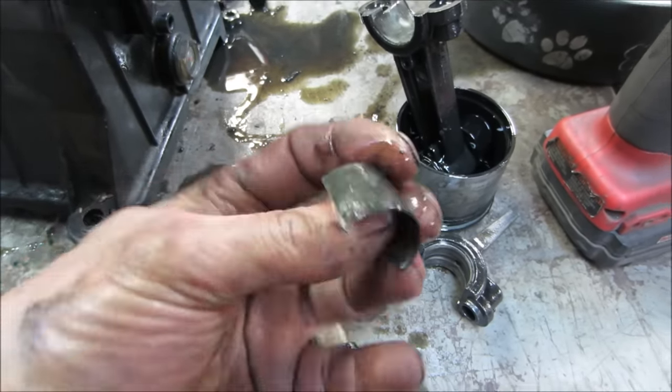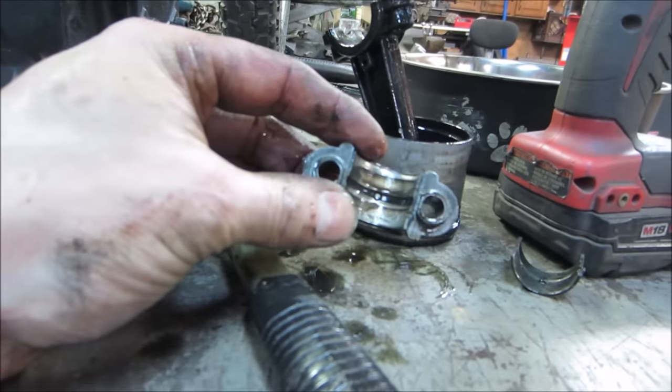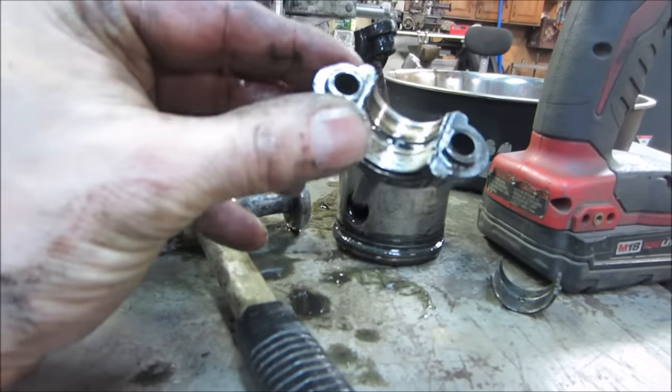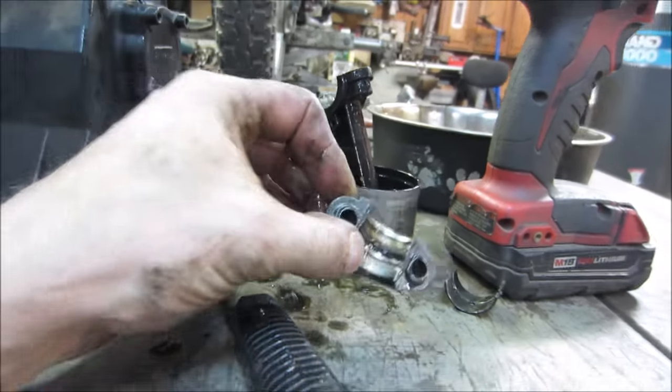It's almost through the bearing altogether. It didn't spin — it's still locked into the tabs. Sometimes it's funny how just the one hammered itself to death. It's flat too — you know, a compressor lays on its side, so you can't say one side took damage because it was higher out of the oil or something like that. I hope you can get that out of there. I would think it would have a retaining ring — and yeah, the retaining ring is still there.